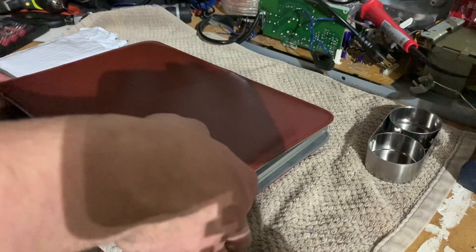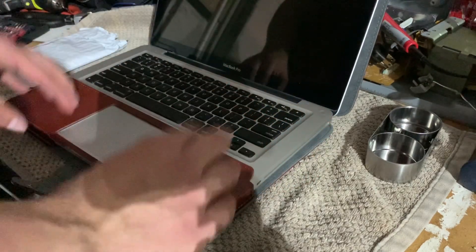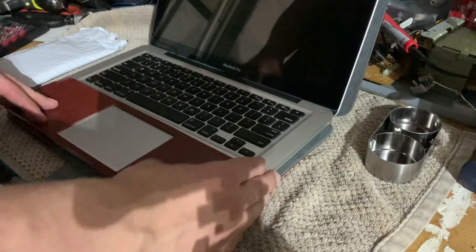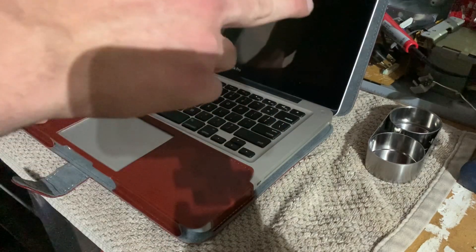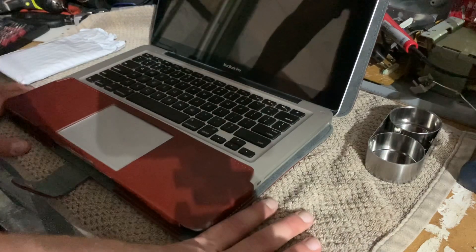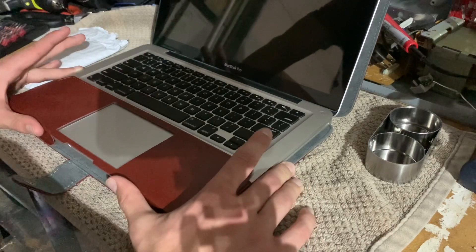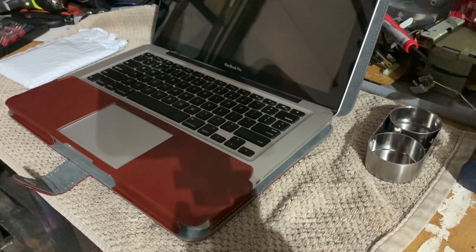Since then, we have upgraded the SSD pretty recently, and we also did a RAM upgrade. The SSD is 128 gigs — not sure exactly which one's in here, but when we open it up we can take a look. I went ahead and put eight gigs of RAM in here, but this MacBook only supports 1600MHz RAM. When I bought it, they accidentally sent me a 1333MHz RAM kit, so there are error messages when I try to turn it on and it won't boot.